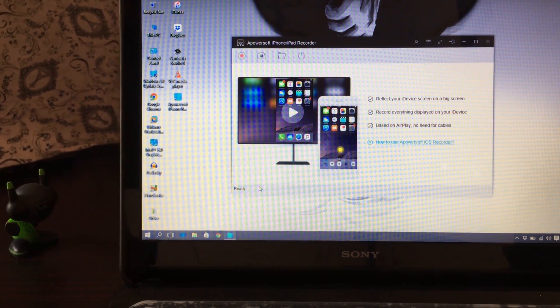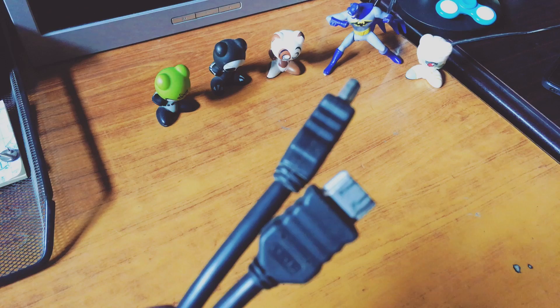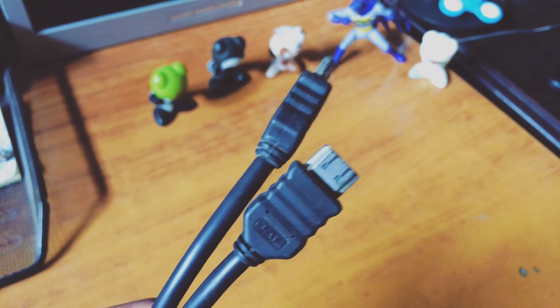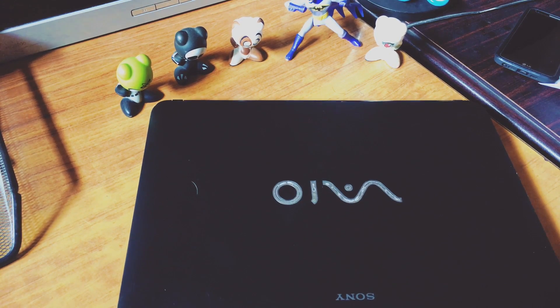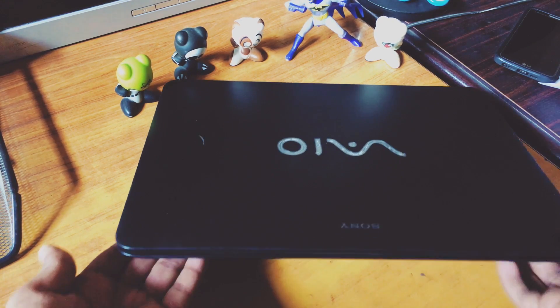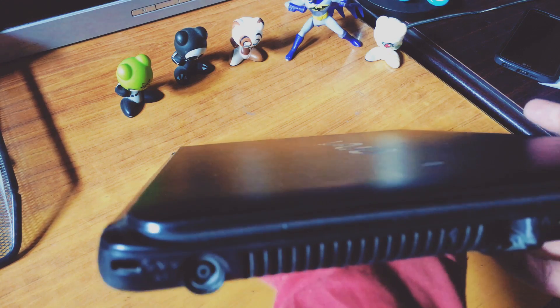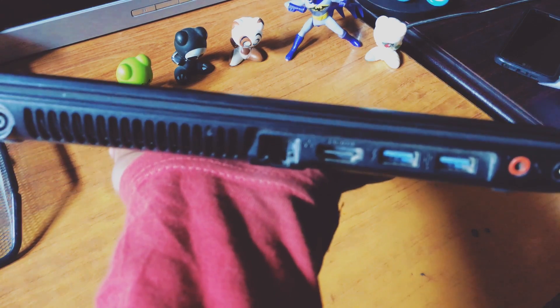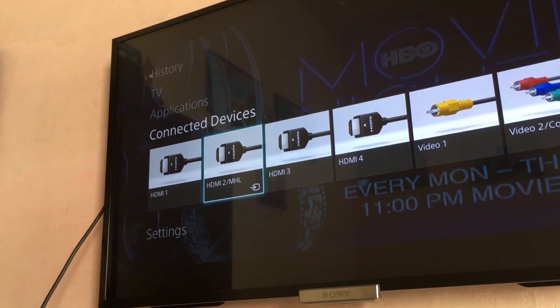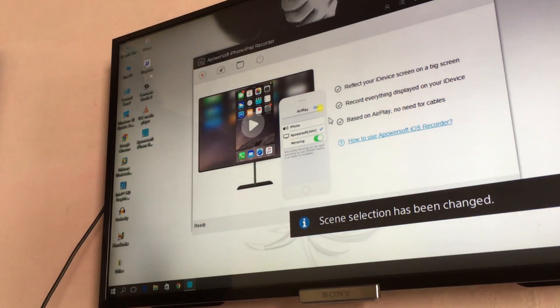Let me show you how to do it. These are the HDMI cables I've got — I got this one for about 2 or 3 bucks. Take your laptop and you'll see an HDMI port on it. That's pretty standard for new laptops, but if you have an older one you can use a VGA cable. I'll be using HDMI since my laptop supports it. Once you connect both, it will show a source icon on the HDMI channel — click on it and it will connect your laptop to your TV, as you can see in my video.